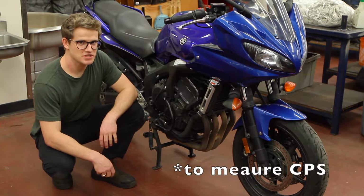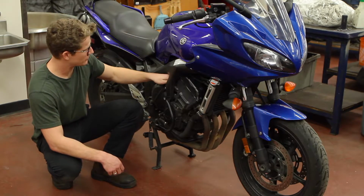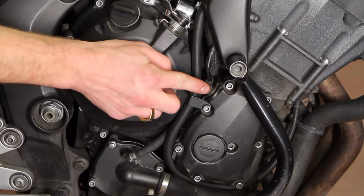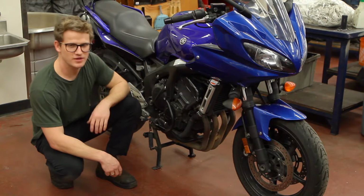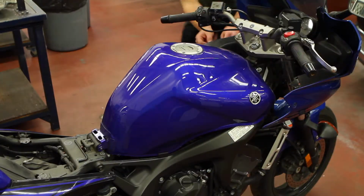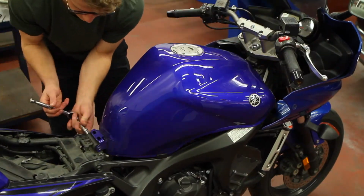To get to the crank position sensor, we'll have to either lift up the tank or take it off entirely to access the wiring up here. When you look up close, you can see that the wire feeds under the seat, under the throttle bodies here. So tank off or lifted, plastics out, seat off, and we'll have good access to it. You're also going to need a multimeter for this job. Let's get into it. Check out one of my other videos on how to remove the gas tank and plastics. Link will be in the description.